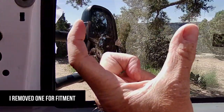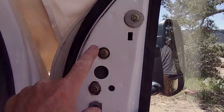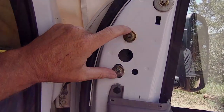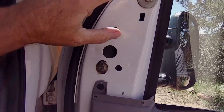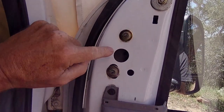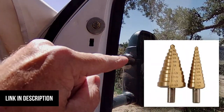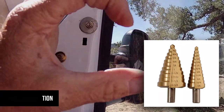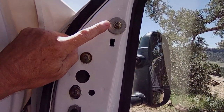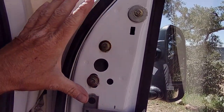The posts had a long bolt on the end that comes through your door frame and then you put nuts on it. There were not holes that lined up for all of these — some but not all of them — so I had to drill holes using a step drill bit, the ones that are brass colored and shaped like steps with varying diameters. I had to drill through the door frame so these mirrors could mount. Not a big deal.